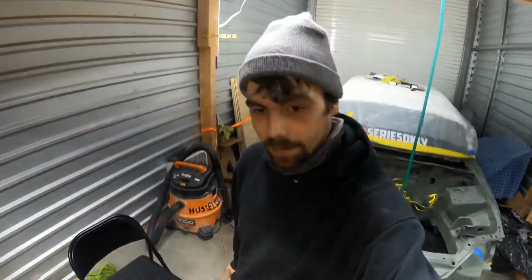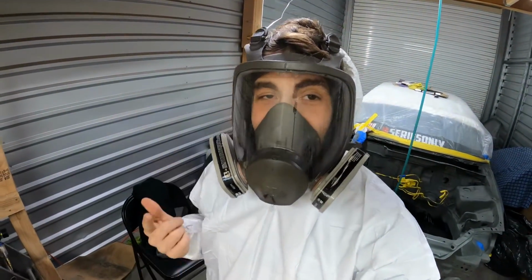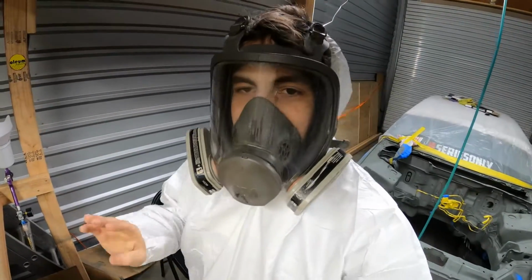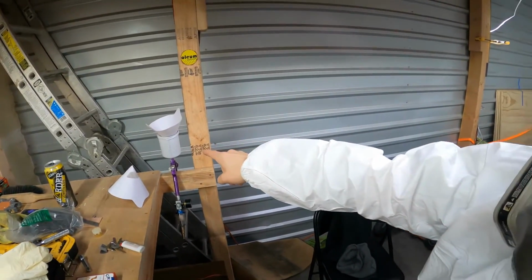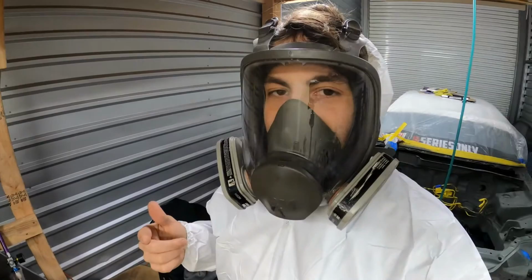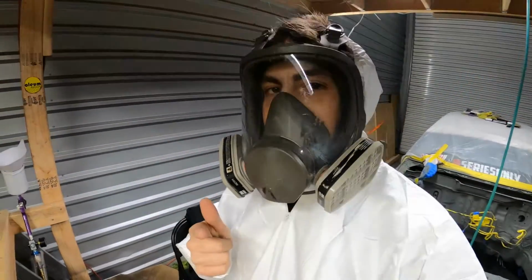So today I'm going to be getting out of this outfit and into this. Now that I got my proper painting clothes on, now you can see my hair and stuff, I'm not going to worry about it. I'm going to go ahead and mix my paint into my gun, put it through the strainer, and then I'll show you guys the color of that. Then I'm going to put the cap on it, wipe that all down with the tack cloth, and get the painting. So, here we go.